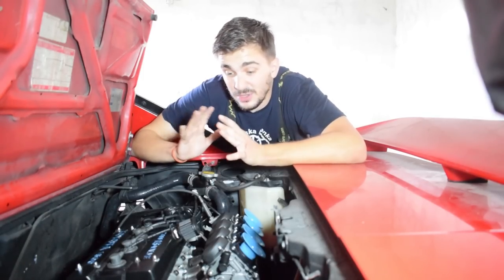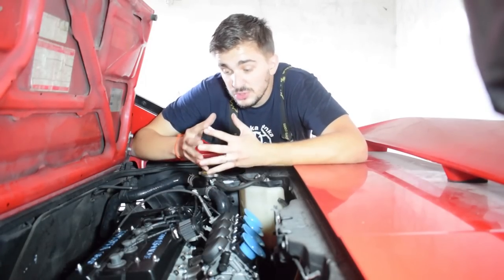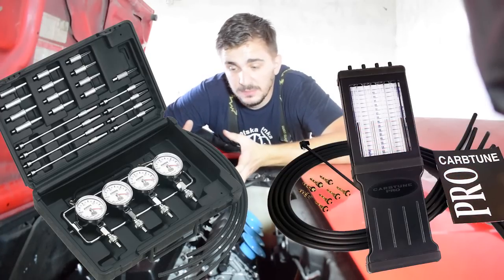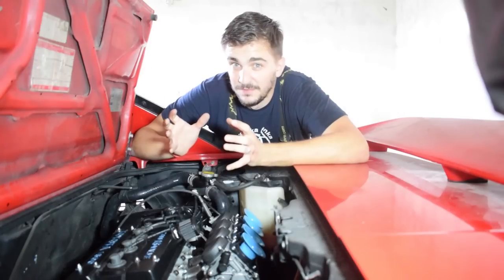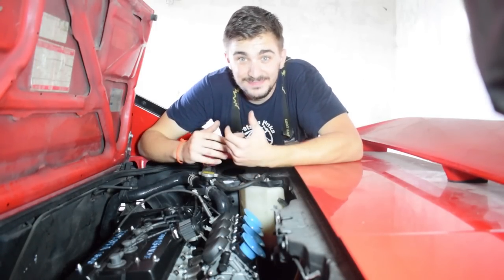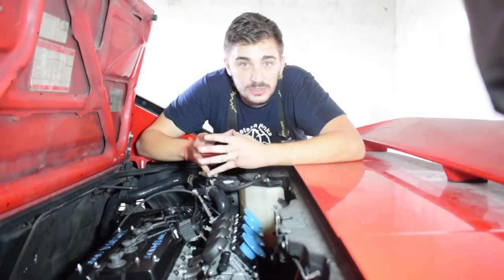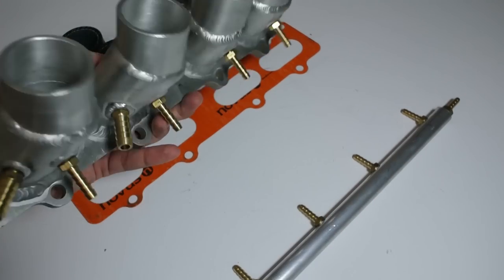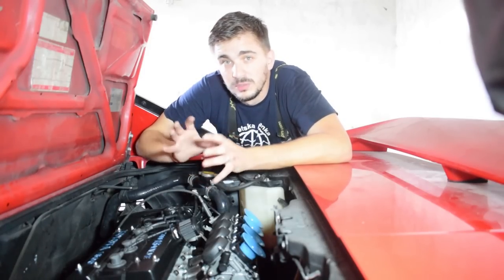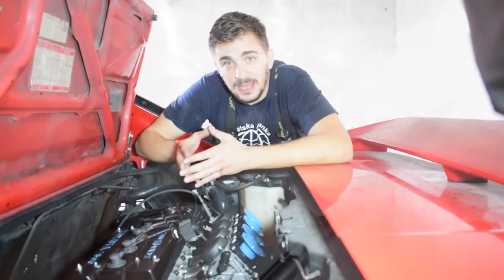The method I'm going to show you today takes access completely out of the equation. Challenge number two is the particular tool you're going to use. The most common way to balance bike carbs is to use either a set of vacuum gauges or a special tool made for synchronizing bike carbs. Both require you to hook up vacuum gauges somewhere on the intake side of the engine before the carbs. That may or may not work on a car engine, because when installing bike carbs on a car engine you need a custom-made intake manifold — and unless you're running a MAP sensor setup, your custom intake manifold won't have any outlets on it.